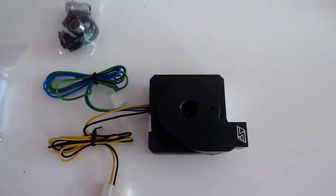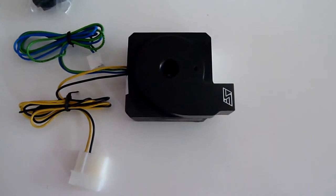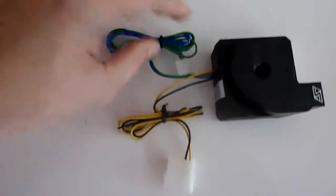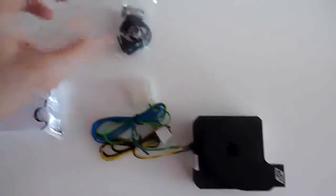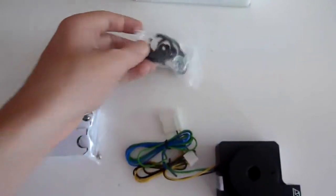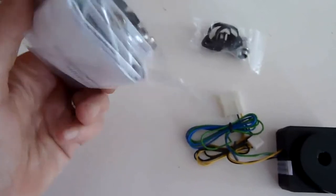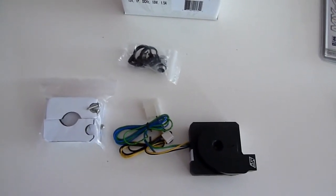Now for a closer look at the MCP-35X. This pump has 22 PSI, 17.5 liters per minute flow rate, and 4.4 meters of head pressure. You have the power connector and the PWM connector to control the pump RPM. Note that the warranty will be void if you install a pump top — so thanks to Swiftech for that. It comes with two 1/2-inch barbs and clamps, mounting screws, and a neoprene pad used to reduce vibration — you can also use it to stick the pump to the case. Very powerful little pump, and I will have two in series.